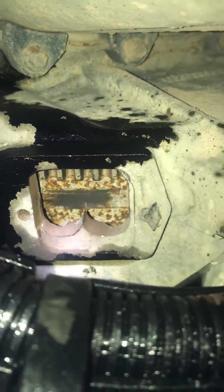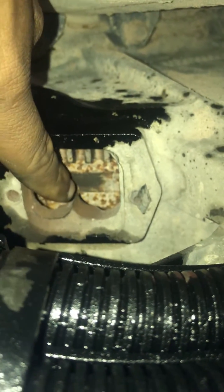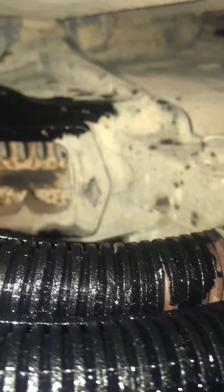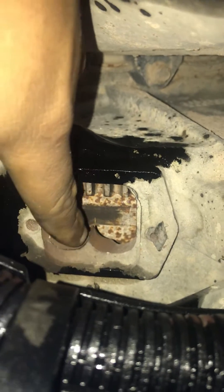There is a mark on your flywheel — there is that mark right there — and you're gonna set it to this right here. It has to be straight, it has to be pretty straight. You don't want it to be up here; it has to be equal right here, straight up.